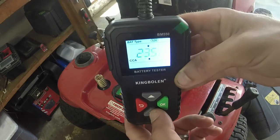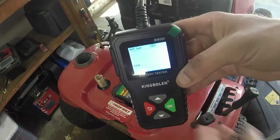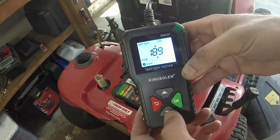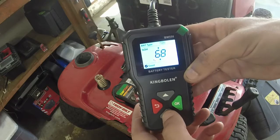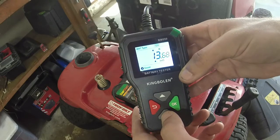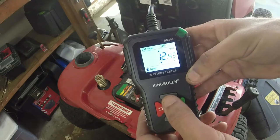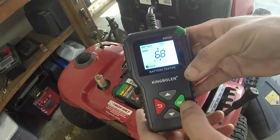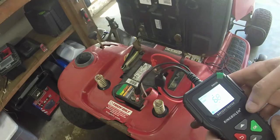This thing is going to test now — let's see what we got. It says tested good. It still has 189 cold cranking amps, which is more than what most people have in these things. State of health is 68% — I knew this thing was starting to get a little weak. State of charge is 71%. That milliohms reading — I think it's 13.68. Voltage is 12.43 volts, which is pretty good. So this thing's at about 68% health and it still says good — kind of cool.